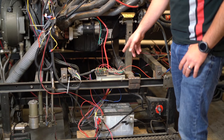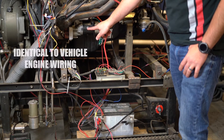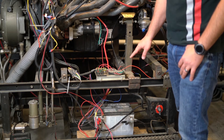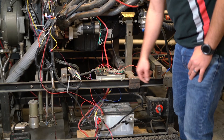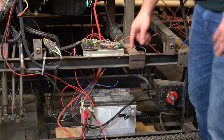We're going to hook this up to a battery charger, get it charged back up, and we'll show you a couple other checks. We removed the heat guard off the side of the engine stand to show you some of the workings behind it. As you can see, we've got our starter, a fuse block, and a battery. All of these spots may be tempting to hook up the battery wire, but going to the starter or to a fuse block is not a good choice. Your number one option is always going directly to the battery positive post.